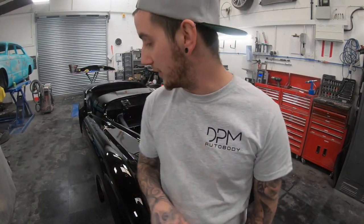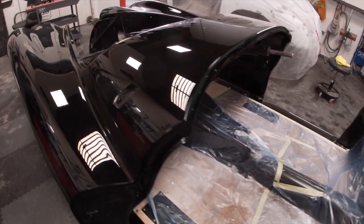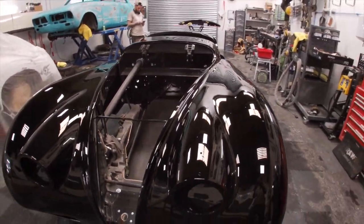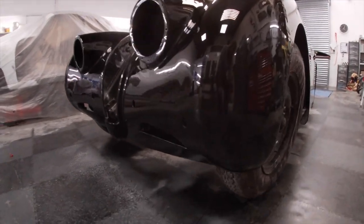So that is the Jag shell now all polished up in its first initial stage. We've gone around the same procedure as what we did on the back panel. Now we can go around and inspect the panels, see if there's any little ripples or flat marks that we've missed and address them — 1500, 3000, 6000, and then just polish them up. We're now going through the next job of fitting up all the panels — going to flat and polish them probably tomorrow, and then the scary task of getting them fitted back to the car.